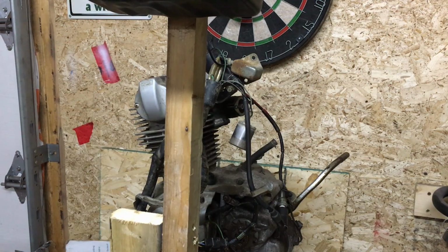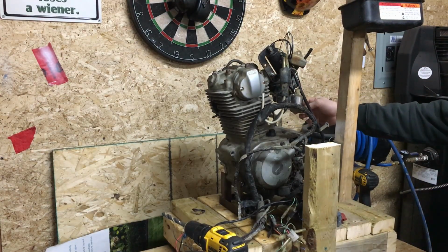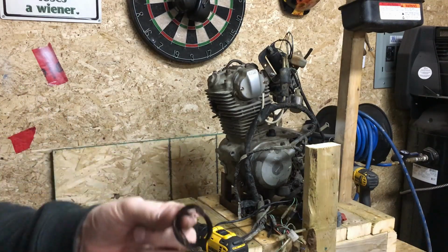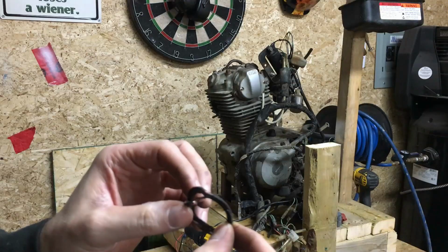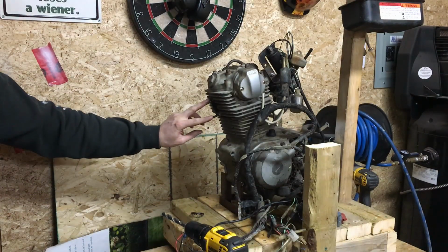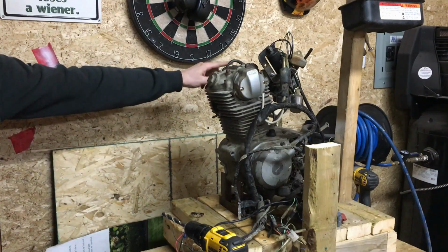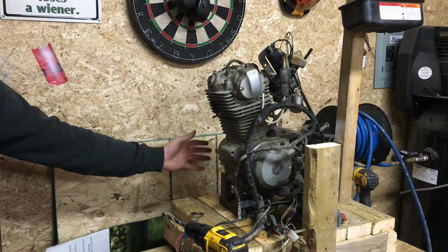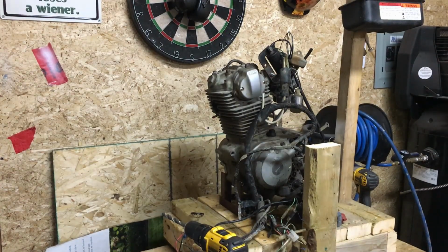So what I need to do now is get a petcock or something to install in that tank so I can get gas out of it and have a shut off on it so I can work with it sensibly. So I went ahead and put the carburetor back on. I'm pretty sure that's ready to go now for a test run. The other thing I did was pick out the old copper gasket. It's pretty toast. So I've got a couple of these on order now, as well as a couple new studs, so I can replace the stud that belongs up here. Once I get those studs and the copper gasket, I can then properly mount the muffler up, so the muffler's going to come off this and go back this way. Then I can also use a piece of steel or something to put a metal strap onto to hold the muffler in place. And then I'll be content to get it going and know that it'll run as expected anyways.